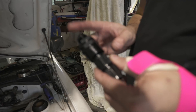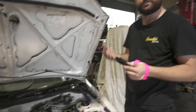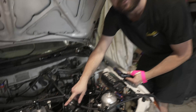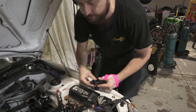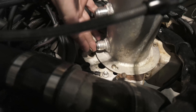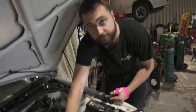We have a one-way valve here for the mechanical pump. The problem with mechanical pumps is they don't prime like an electric one does - the engine turning is what causes fuel to come through. By having this valve we're hoping to keep fuel in the line when the car's not running, so when we start it we don't have to prime the pump - it'll already be primed. It's going on the bottom of the surge tank, and that line follows all the way around to the bottom of the mechanical pump.